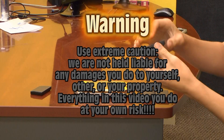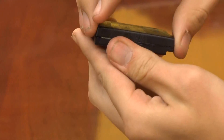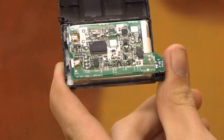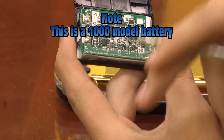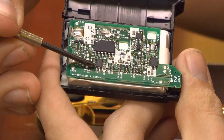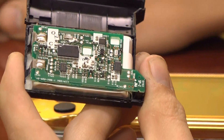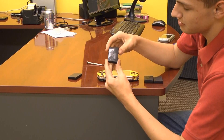We are going to show you how to make the hardware mod Pandora battery. It can be done with either the fat PSP battery or a slim PSP battery — both work the same. Take an exacto knife and cut around the edges of the battery to open it completely and take it apart. Be careful not to push in too hard or you can puncture the battery and ruin it. Once you have the battery open, find the chip labeled IC04. There are four pins on each side. Take your exacto knife or soldering iron and remove the specific pin. As you can see on this battery it has already been removed. Once you break that pin off, make sure it is not bridged with one of the other pins. Once the pin is removed, it has become a Pandora battery. Just close the lid, tape your battery up, and that is a hardware modded PSP battery.